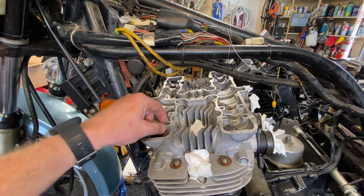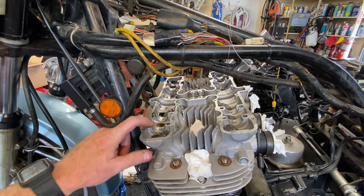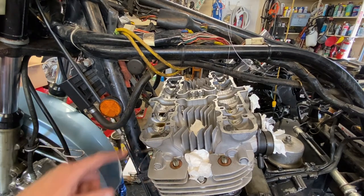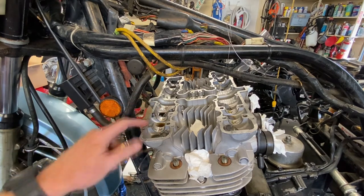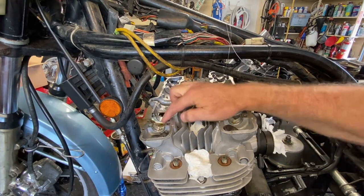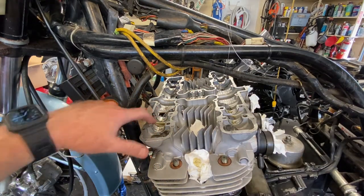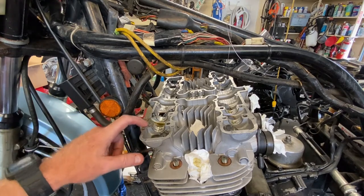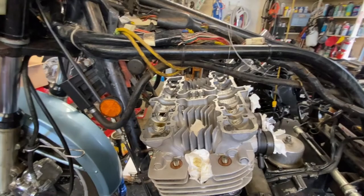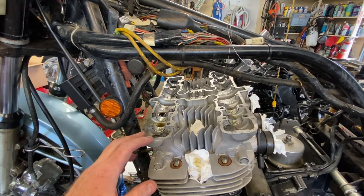I'm going to go off camera real quick. I'm going to take these bottom camshaft bearings out and label them. They have to go back in the exact same spot, assuming I use them over again, and I already have each one bagged. For example, this is number one cap here on the left front. It'll say it actually in the block here somewhere, like here it is, Z1. There's a one right there. It's kind of hard to see. So this is in the casting, rather. So anyway, there's number one. We want to label this one L for left and then one R for right, and do it that way. I'm going to do that off camera and come right back. I just want to secure them so when I tap on it and start moving it around, they don't fly off and I lose them.